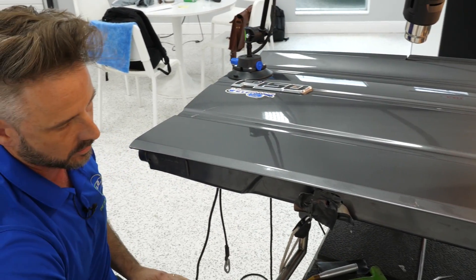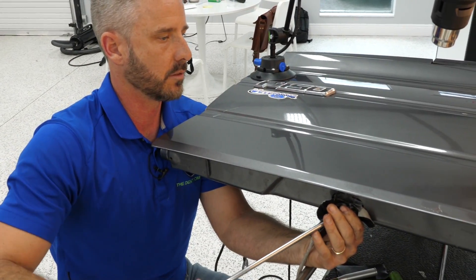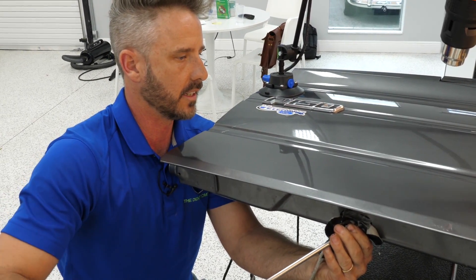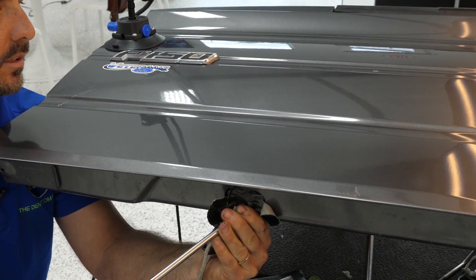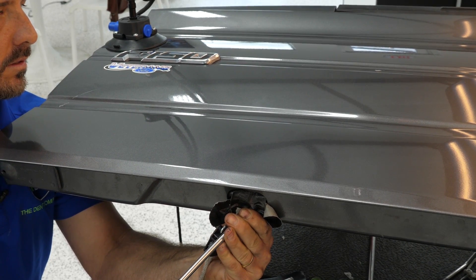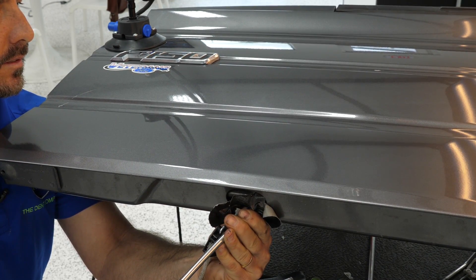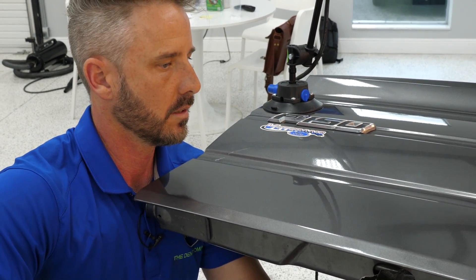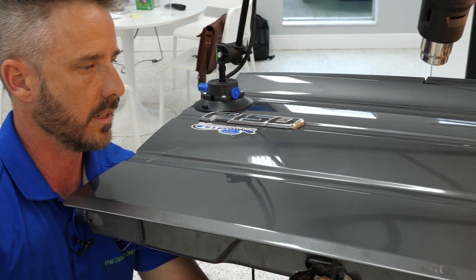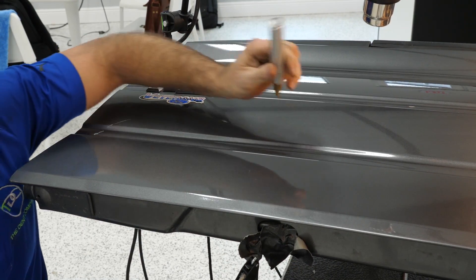All of those taps are specific — there's nothing general about what we do. A lot of times people think they get a dent and it just popped right in, but there's nothing about PDR that you get to just pop it right back out unless you're in a glue pull position. You're massaging the metal back with direct, specific pressure, and we stare at about the size of a pen tip. You can actually physically see the tip through the metal — that's what the light really helps with. The new lights really made a big difference.